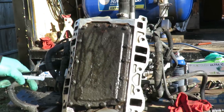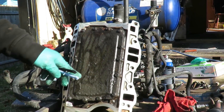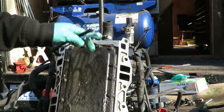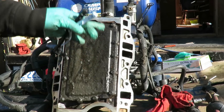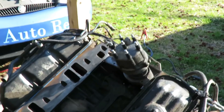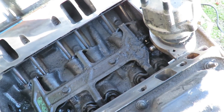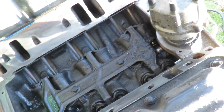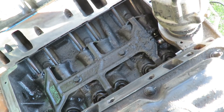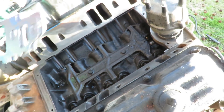Alright guys, I turned the intake upside down and cleaned it up nice and clean. This thing is as cruddy as anything. I want to be very careful — I do not want to start scraping this old stuff off, especially down into this engine. I do not need LKQ or whoever to say he scraped that stuff off and it went down into the engine and clogged up the oil pump screen. You will not be blaming Astro at all for this.